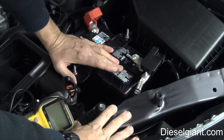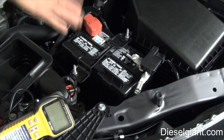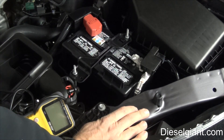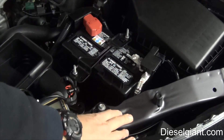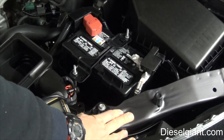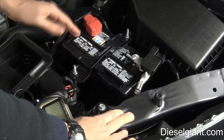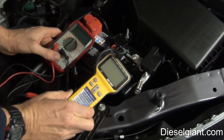I'm going to continue using the battery desulfator on this battery to see if I can get the milliohms down closer to 3. If I can get it around there, that will tell me the plate sulfation has nearly been eliminated. The battery tender junior is the desulfator I use — it's a trickle charger with a computer circuit board that won't overcharge the battery. It shuts down when the battery reaches the specified charge and pulses the charge to remove sulfate from the plates.